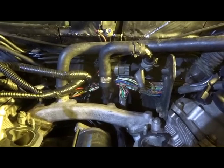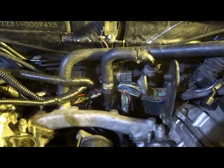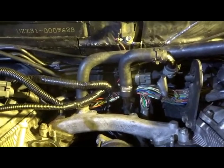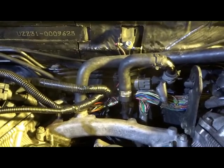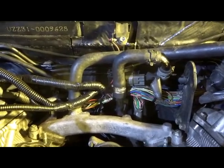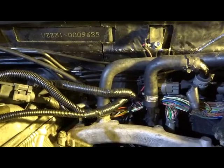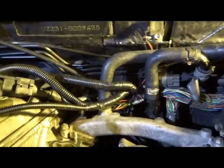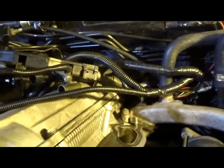Okay, the plastic harness cover in the back there, which goes across that pipe which joins the two heads together, which is a water pipe, wouldn't let the rubber hoses which go onto the intercooler go down, and they couldn't reroute them. So I've taken the plastic cover off and moved all the wiring basically behind the two hoses there, but where the joint is in the middle, as you can see, I've brought them back in through the front. Hopefully we'll have enough length to get it all the way back down to the positions at the front of the head, because those other ones there go up to the front for all the switches, etc.